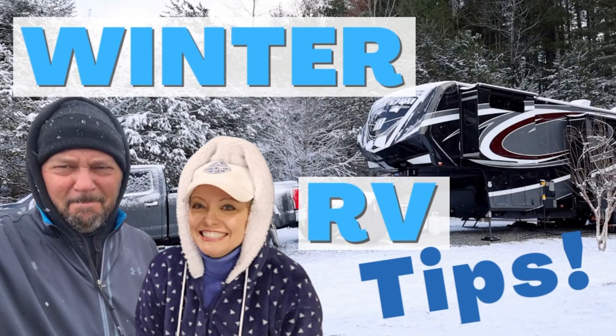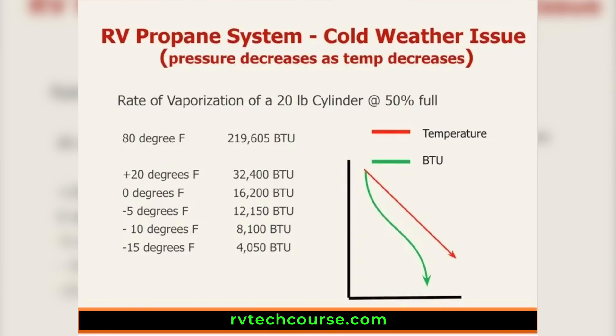The rate of evaporation available in a tank varies a lot based on temperature. These two things are very important when you're camping in the winter. As temperature goes down, propane vaporizes slower and slower. In fact, our 35,000 BTU furnace needs 35,000 BTUs of propane flowing through it. Check out this chart from the NRVTA — you can see that at zero degrees, we're not gonna get enough boil-off to feed our furnace. That's also when you'll get into things like tank heaters.